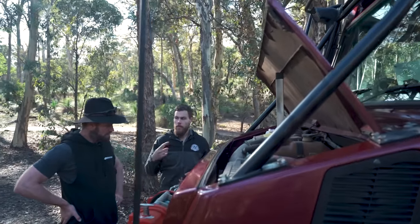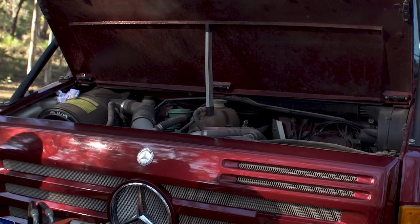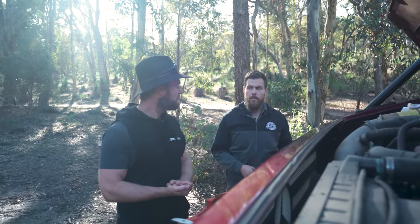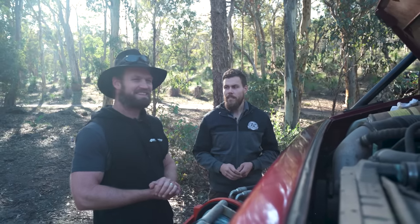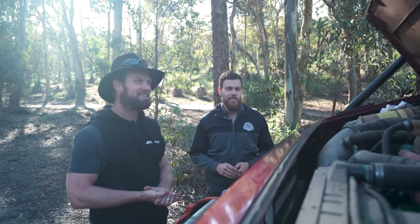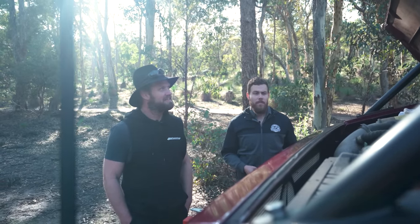So I'm just sort of free spinning a belt rather than having it under load the whole time. Yeah, just taking that weight off of the engine. We got the injector pump modifications done. We added on the intercooler, and that definitely boosted up the power. I've tried to take it to a dyno a few different places and kind of got the starstruck face of, like, you're not putting that on my dyno. So I have no idea exactly how much power, but somewhere maybe close to 300 horsepower. Okay. And I don't really know the torque stats, but it definitely gets around pretty well.